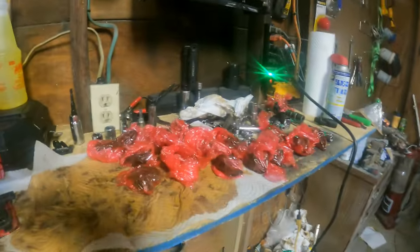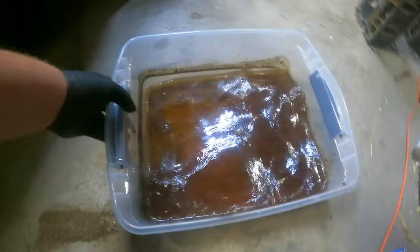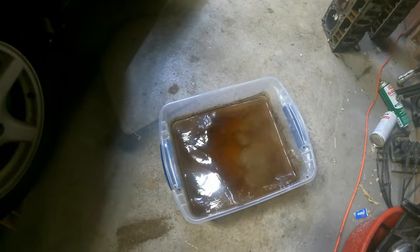As you can see it's a slight setback. I watched some videos on how to deal with surface rust, and it was suggested that vinegar will pretty much dissolve surface rust. So I pulled all the rocker arms and soaked them in a tub of white vinegar, and it actually worked out pretty well.